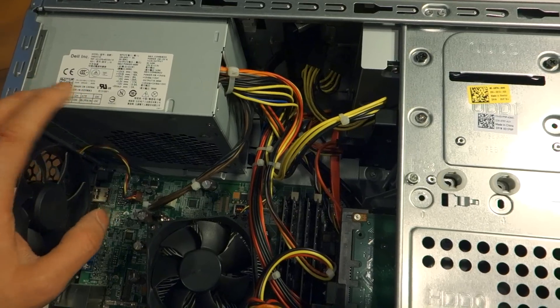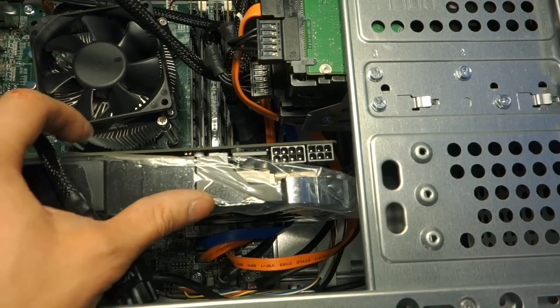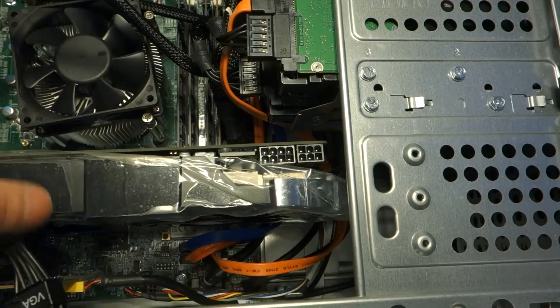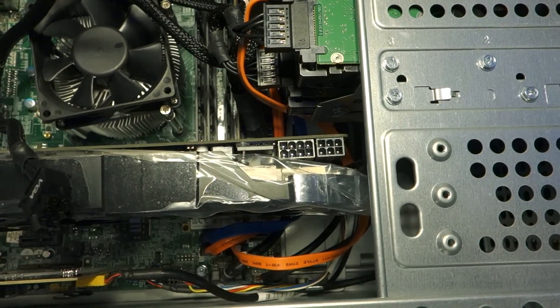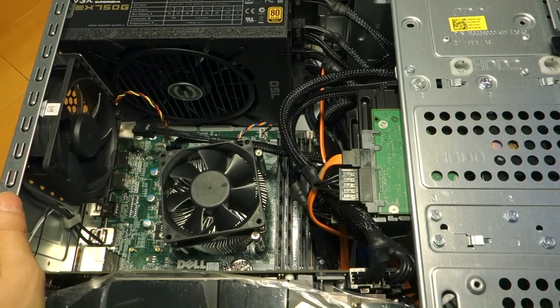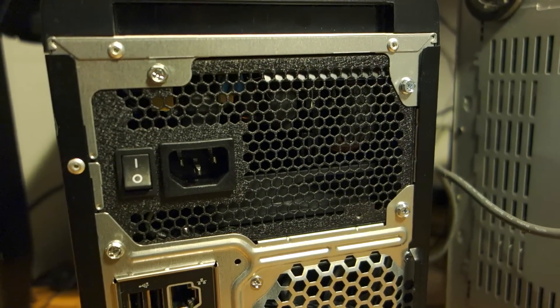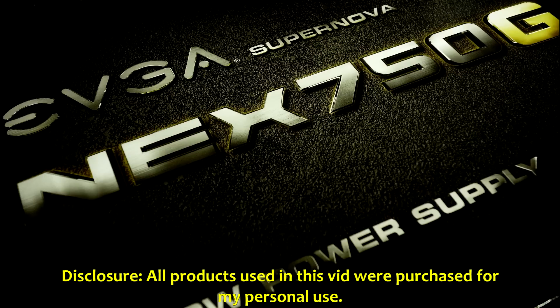Last but not least, I've got the HD 6970 installed back in. It's a particularly long card so you have to watch all the SATA and other cables, but here you can see the 6-pin and the 8-pin connections. I've kept the wrapper on because I want to make sure it works before removing it in case I need to send it back. And that's it - all cabling in the XPS 8700 is complete. It sits nice and flush in the original spot. Please like, subscribe, and share - and as an FTC disclosure, none of the products were sponsored; everything was purchased for my personal use.